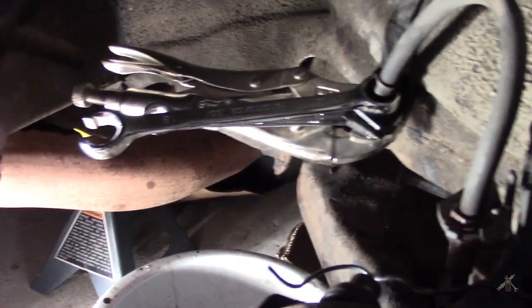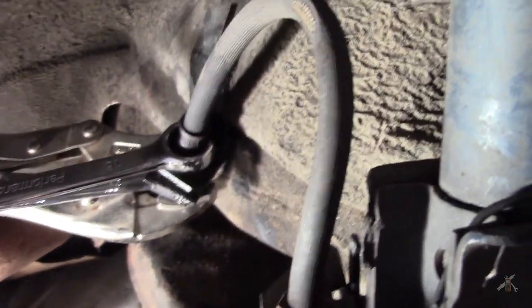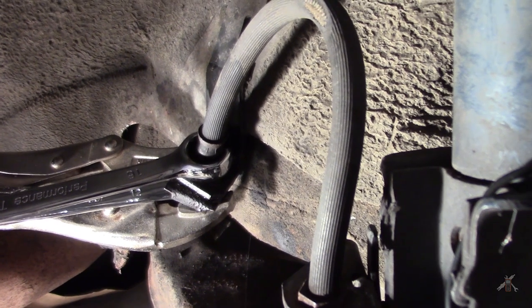You've really got to watch out from a safety standpoint, because there's undercoating up in here that you can set on fire. And the second thing is, brake fluid is flammable and the hose can burn.